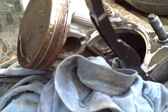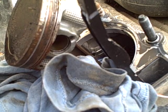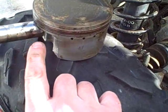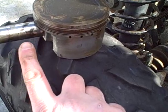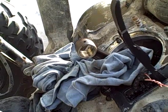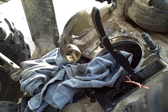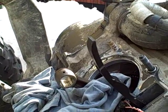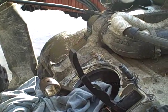First I'm going to clean up this piston since it's pretty scuzzy - it's a mixture of penetrating fluid, rust, gunk, and carbon. Once you remove one of the retaining clips you slide the wrist pin out, tapping it from the other side, and once it's out far enough you can free the piston from the top of the connecting rod. That's pretty much it for out here - my hands are getting very cold. I'm going to clean up my tools, stuff a rag down in this hole, and cover it with plastic so rain or snow doesn't get inside the motor.